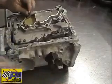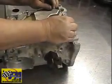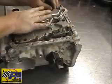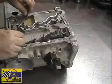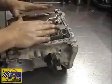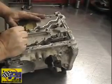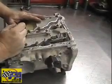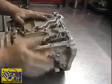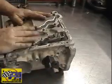And these bolts don't require much torque at all. They're about 10 to 12 foot-pounds, and that's about it. Don't recommend using an impact gun. I'm doing it here a little bit because of the demonstration. But you will torque these down. If you don't have a torque wrench, they are snug with a single 3/8 drive ratchet. We'll get it snug down. Our linkage is checked. We'll put the pan back on, and then you're done with this.